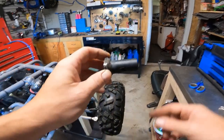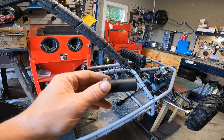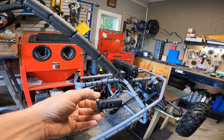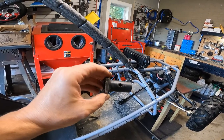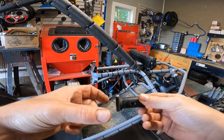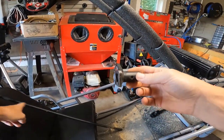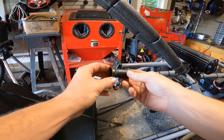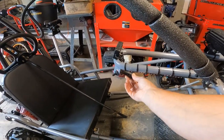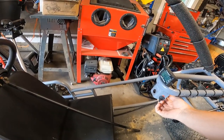What we are doing here is the actual bottom steering arm. I'm gonna take it and modify it — I've already cut off a part of it. What I'm doing is I'm gonna have it as a carrier for the steering rod. I'm actually going to weld it up behind here for the steering rod to go through, so it gives it some stability.